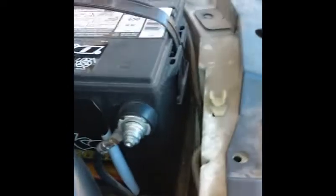Now, looking at the engine bay from the passenger side, you'll have your computer here. This car is an LS Sport so it has cruise control — you may not have cruise control and that'll be one less thing in your way. In our modified cars we've moved the computers to a different location, but we'll leave it here for this video unless it gets in the way. Before you get started, always take off your negative battery cable — there are a lot of sensors on these cars and you could easily mess something up if you fray a wire while it's plugged in.